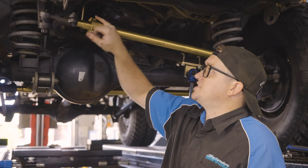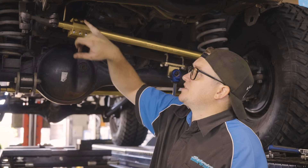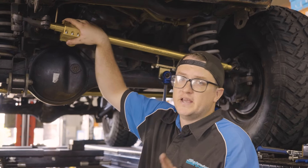With your dampener bracket, obviously as there are six bolts, you're not just going to want to crank up one end and work your way down. You just want to step back and forth across the bracket. That way it gets super even clamping force around the whole drag link across the full length of the bracket, giving you the best fitment.